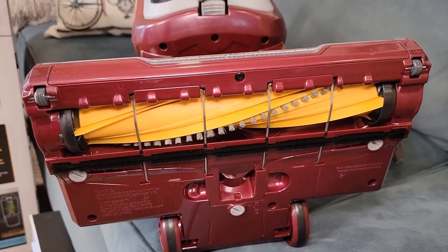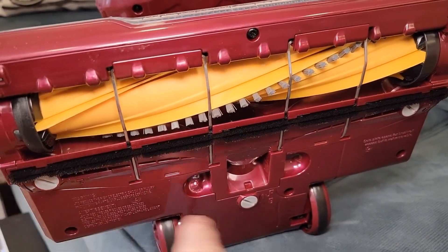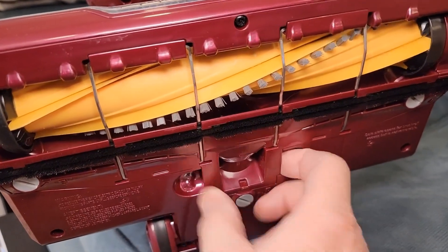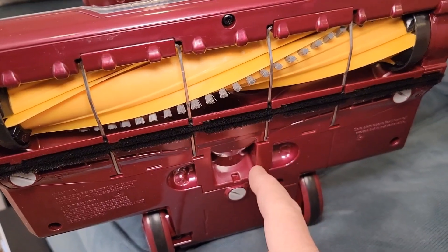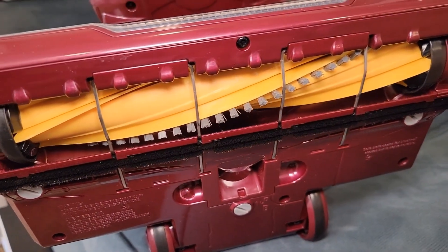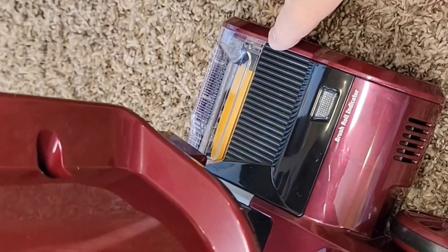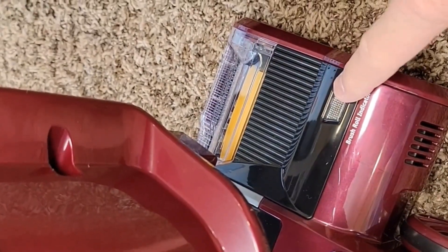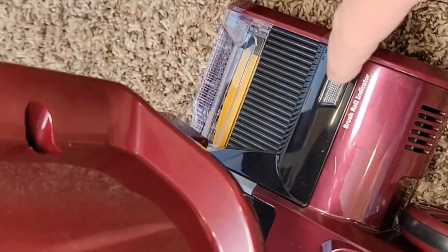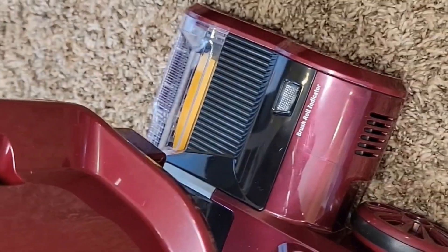Here's what the bottom of the vacuum cleaner looks like — it's called a self-cleaning brush. I like that you can open up this little area here and clean out anything that gets stuck in there. You can turn these little screws right here, open that hole up, and get it cleaned out. We do have a brush roll indicator: if your brush is turning at normal speed it's green, if it turns red there's a jam, and if it's flashing red it's overheated and you need to let it cool for about 60 minutes.